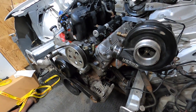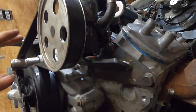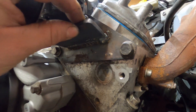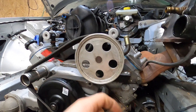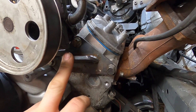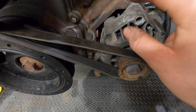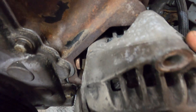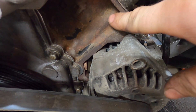I ran out to the shop and finished up the power steering bracket. The water pump is bolted up. The power steering bracket lines up pretty well — I might weld a small piece of steel across it for extra rigidity, but it's solid and the belt tensioner will pull it sideways rather than up and down, which should be fine. For the alternator, the bolt hole just doesn't line up to the block — I'll need to grind a little bit of material off to get it to line up.